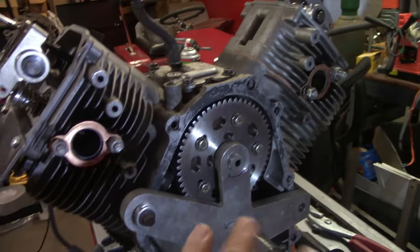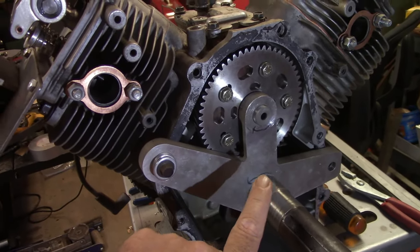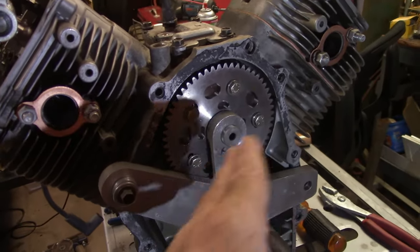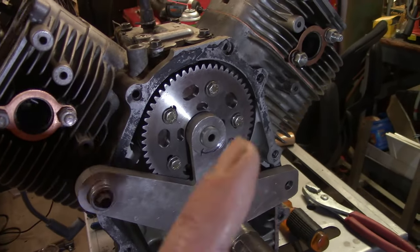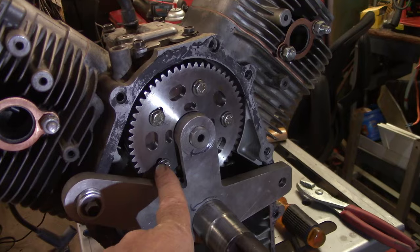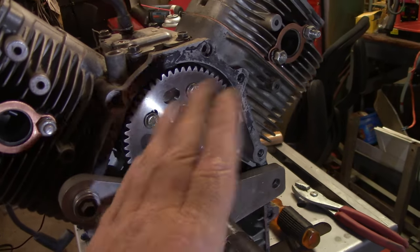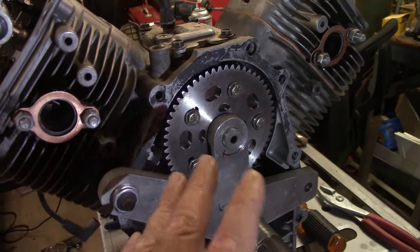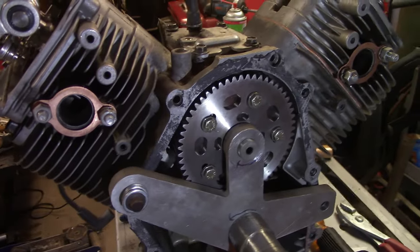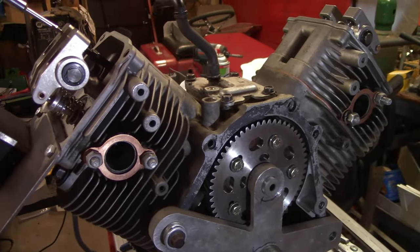When you're working on the Commands, you'll need one of these fixtures — this is from Midwest Super Cub, though other people sell them. It is essential because it keeps your cam and crank lined up and lets you rotate it. The only drawback is there are usually five bolts in the cam and the fifth one is in the back, so I take that bolt completely out so it doesn't hang up. The four will hold it.